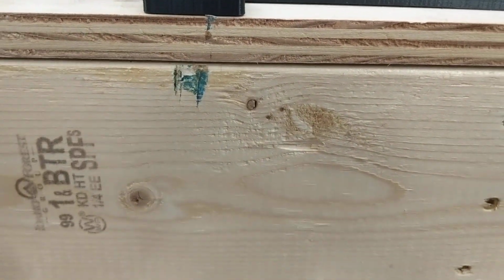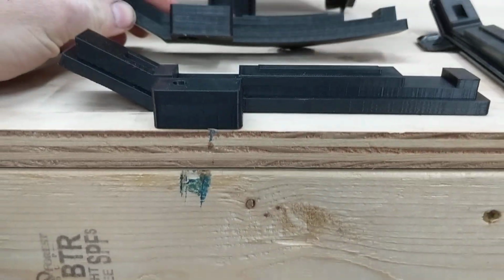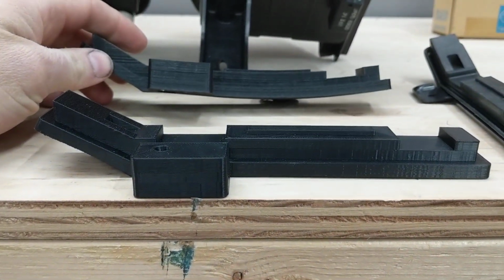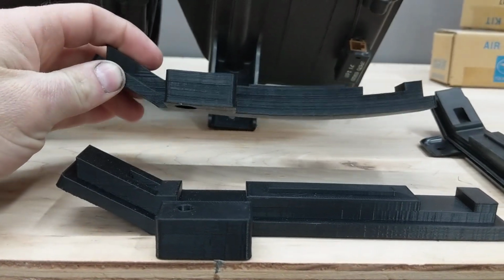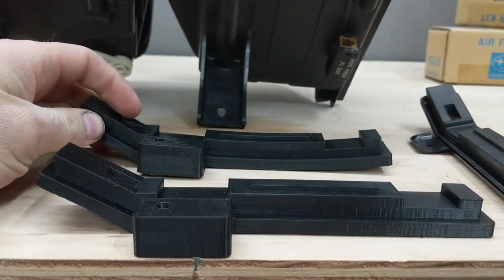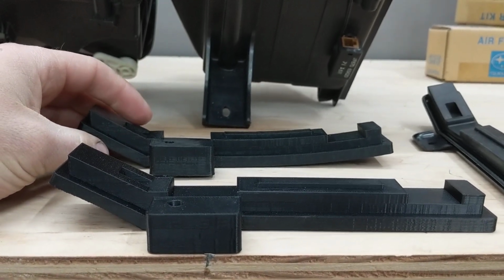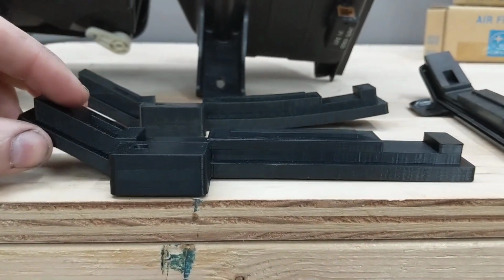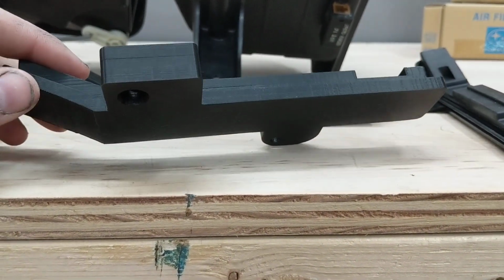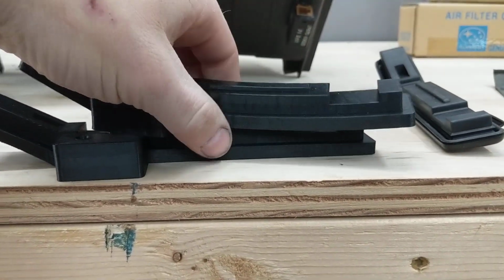And I spaced it on some washers just so the center of it could sag if it heated up. And sure enough, this is what it looks like after half an hour in the oven. It was sagging in the middle. When I took it out, I could have folded the thing right in two. This is another PLA one that hasn't been put in the oven. It's too bad we can't use PLA. PLA is a lot easier to work with.